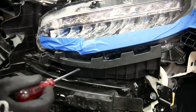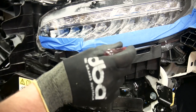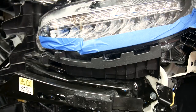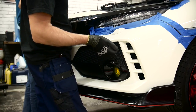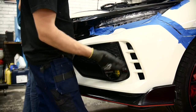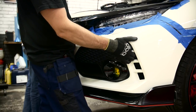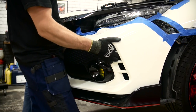The tricky part here is to release the ones that are holding the front bumper. You need to go in here with the plastic device and lift up these clips. There is a third one over here as well. Now we are almost ready to take off the front bumper — we have taken off all the clips and undone the rest. The next step is to detach the front bumper from the car, and it's a lot easier if you have a friend so you can grab one side each. Then you just grab it and it will come off just like this.